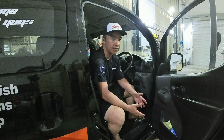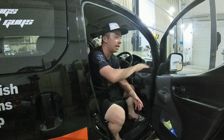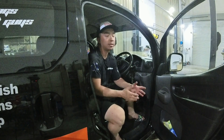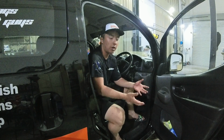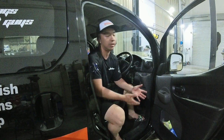So some steam cleaners have heat adjustments, some have intensity adjustments. The amount of pressure you use on the area itself will also affect the cleaning power that you have on the area. So always start with a small area first, and then see if it's okay to use a steam cleaner on the whole panel itself. If you do it on a small area, you don't see any damages, then sure, continue on the whole panel,